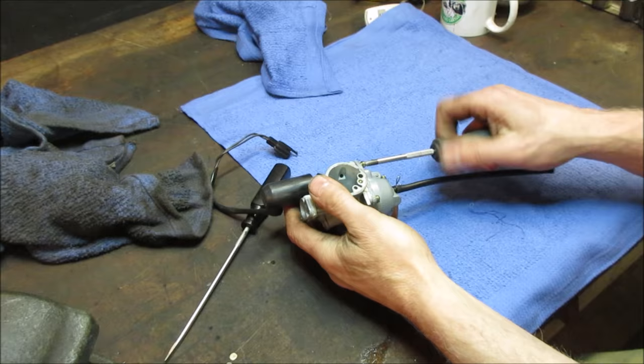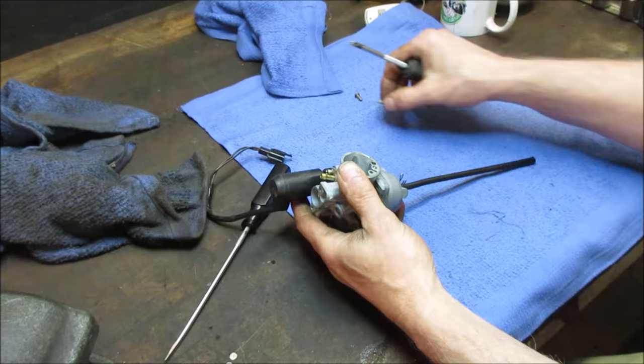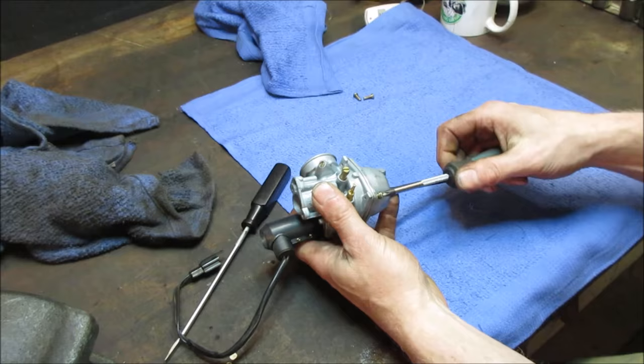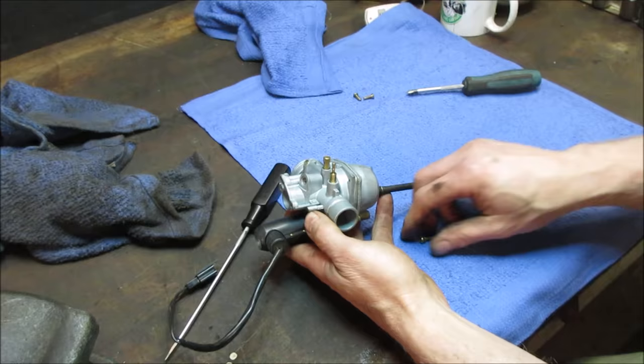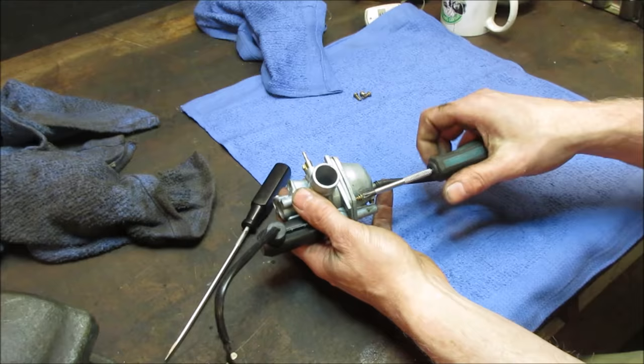In case I didn't explain it, the machine's a two-stroke. A two-stroke does not have oil in the crankcase. It uses a premix with the gas. The gas goes to the bottom of the engine where the crankshaft is. The oil kind of sticks and stays behind, tries to anyway, to do its best to lubricate the bottom end and the bottom of the cylinder walls. Too much causes it to smoke like a pig. So I don't know if we have a problem with that pump.